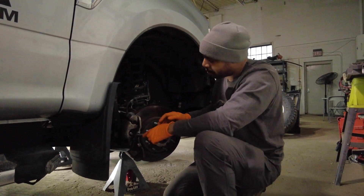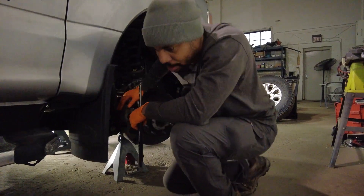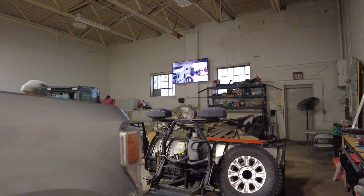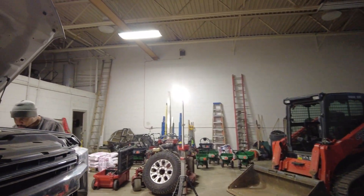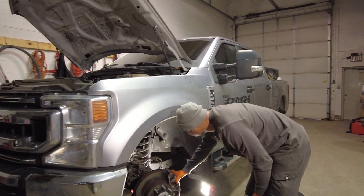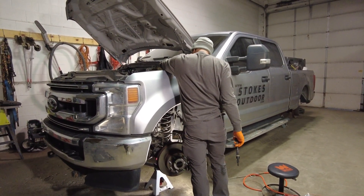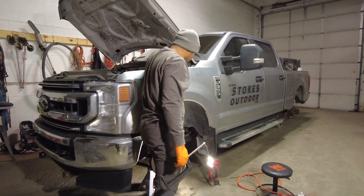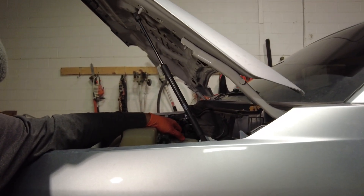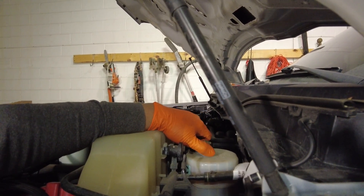That one's feeling like all I can get, reasonably. Let me take that caliper off — they're loose. So if I got these loose and I've been compressing them with the cap on, is there a reason to take the cap off? I should be at the max line on this fluid — yeah, I'm pretty much at the max. I'm still compressed, pretty well compressed. Is there air trapped up in here? Have I compressed this air or did it just escape? The fluid is now up higher, closer to that max line for sure.